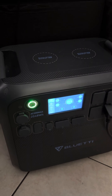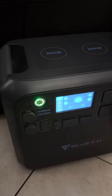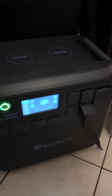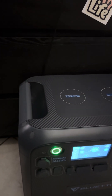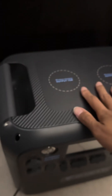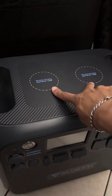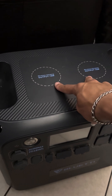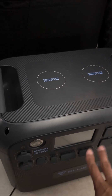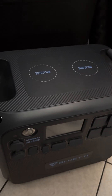First, let's get this apart. There are four long screws and then there are three smaller ones — two in the front, one on the back. When you pull this up, be careful because you have the two wireless chargers right here on top. There are going to be two connectors right about here on the inside, so don't just pull straight up.